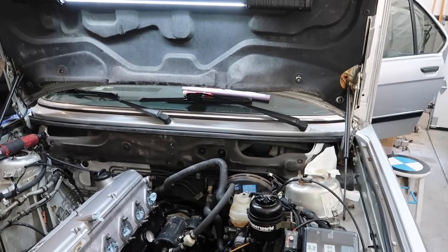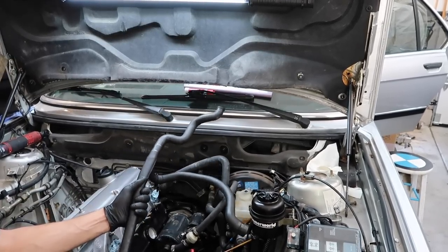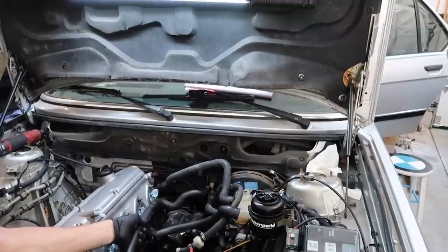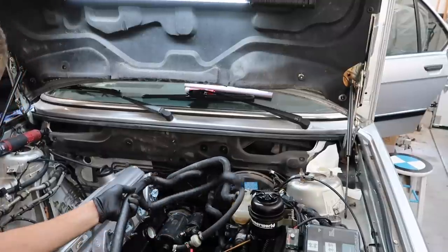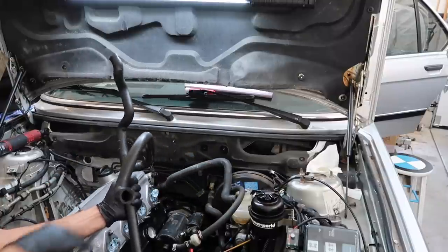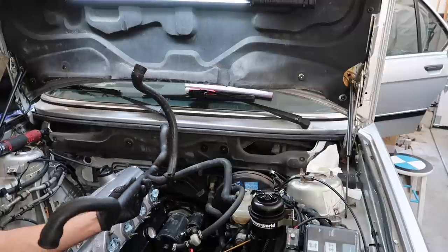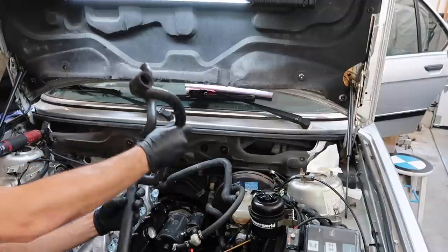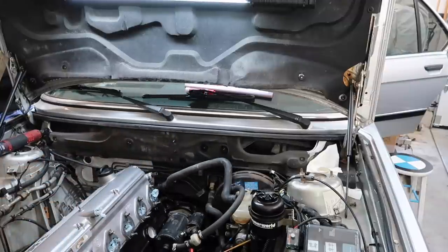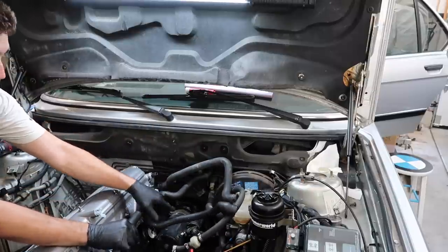So first off, from your donor car hopefully, we have the spider hose, which will go from the thermostat housing here in the front, goes to the back to the heater core inlet, and then this goes to the expansion tank. Now when you look up part numbers, it gives you this arrangement in three different hoses with a union. I don't know where I got this from or how to get it. The part number doesn't even pop up, but I'm lucky enough to have a one-piece hose, which is way better. So I will use this instead of the three hose method, less places for leak.